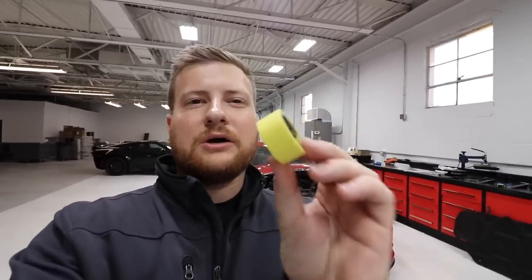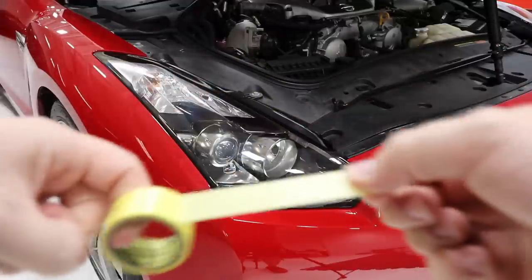Kamikaze tape comes in three different sizes — quarter inch, half inch, and one inch — and it's about four dollars a roll. A little pricey, but once you use it you won't go back to any other tape. You use a lot of tape when you're paint correcting, so get used to getting good tape. You can get it at Esoteric Car Care. Depending on the vehicle — trucks, bigger cars, lots of emblems and plastic — you want to tape all that off. So we're going to tape up the headlights at the bottom and take extra precautions in this tight area.